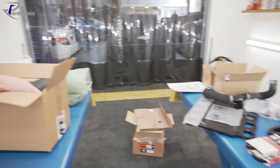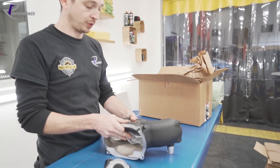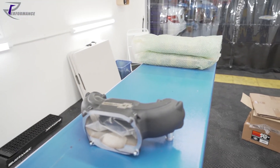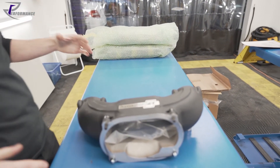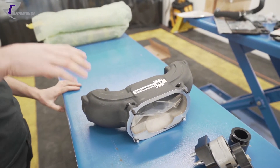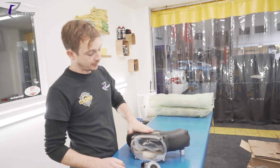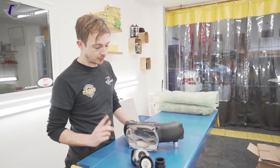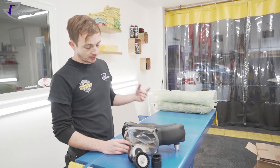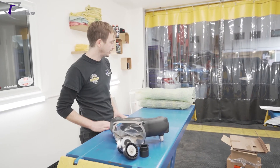This is the intake shroud for the supercharger. It bumps the back of the supercharger and then your two throttle bodies hang off the back. On the standard road car it's bank to bank — one throttle body feeds one bank, another throttle body feeds another bank. On this car there are still two throttle bodies, but they're fed into one supercharger and that one supercharger feeds both banks — that's how we balance the boost out. This is going to be colour coded. The car's had a colour change on the calipers, colour change on the charger, and this will go the same colour as well — so we've tied it in as a bit of a theme.